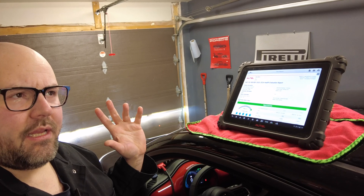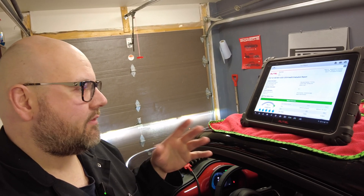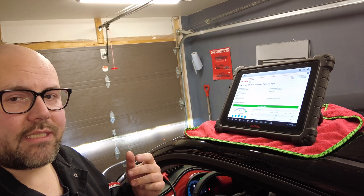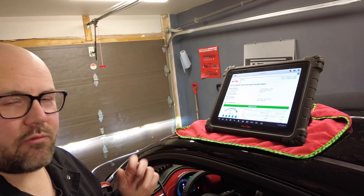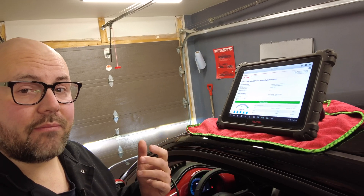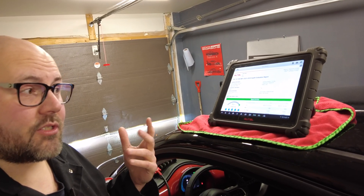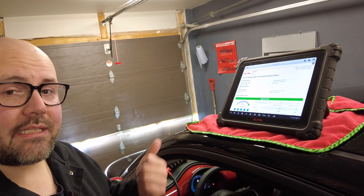I think this is a fairly accurate report because you're actually charging up the car and it's calculating the energy that went into the pack. The report says the SOC started measuring at 32% state of charge, which is strange since we plugged in at 20–21% — I'll have to email our Autel rep about that. A lot of people use Car Scanner or EML, or a Tessie app with Teslas, and those give a rough estimate based on an algorithm. I think this is a fairly accurate test to get a good idea of state of health — and this is very important if you're buying a used EV. I think this is something that should be done, and also if you own an EV, do it every two to two-and-a-half years to gauge the battery.